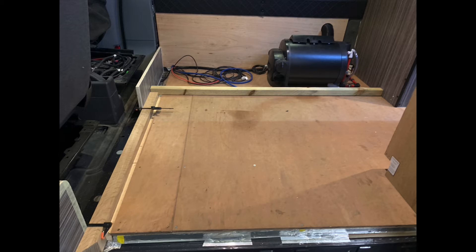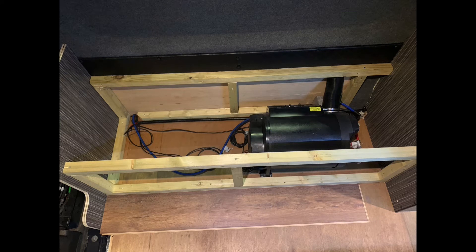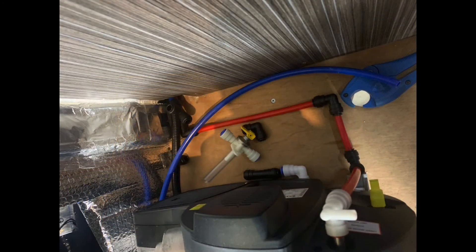The vents aren't in obviously - we have to make some areas for the vents to go in. I marked out where I thought I'd like the sofa, then I got some flooring and laid that down to make sure it was going to be square - squaring the wood flooring against the end of what is going to be the sofa arm. Then I went about making two frames, front and back, mounted the back one to the van. It sits on the floor and I braced it properly so all the bearing weight was correct.